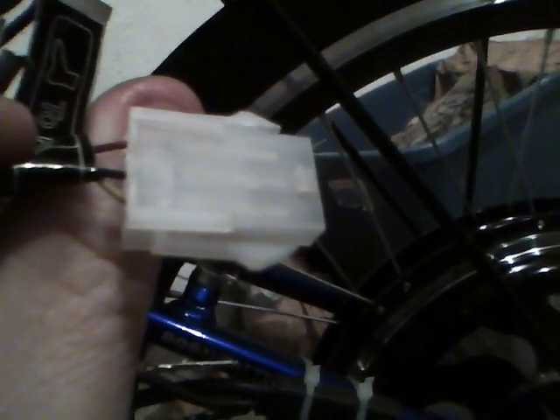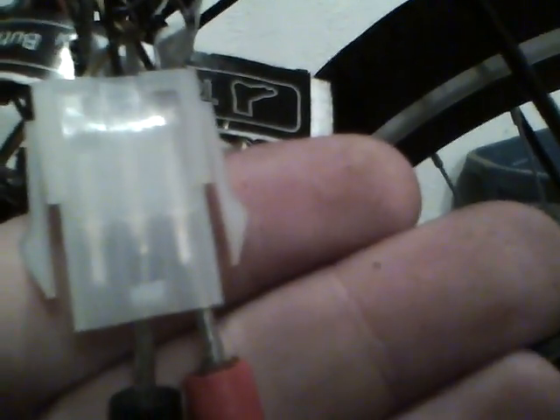The pedal control — I don't know if you can see — has three wires coming out of it: a red, a black, and a yellow. This diagram only shows one plug. If I take the multimeter probes and stick them in there — positive on the red, negative on the black — I've got the probe stuck in there, red to red, black to black — there's my five-volt feed. But it's not interrupted by that switch up there. If I use the negative terminal on the LED lights connector, what the hell's going on? What's that switch hooked up to? Does anybody have a Magic Pie 2? Has anybody figured this out? Thanks.